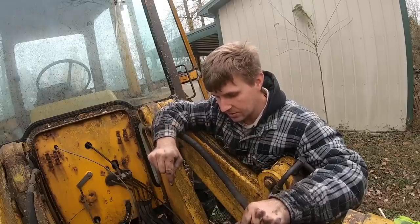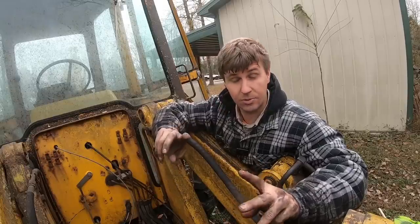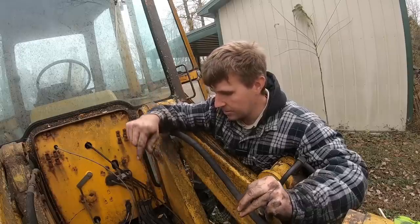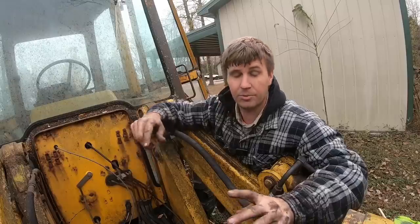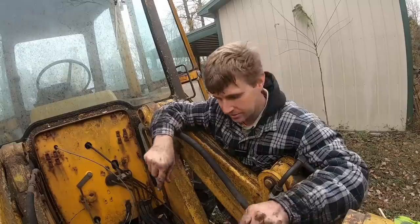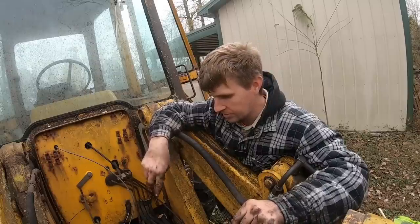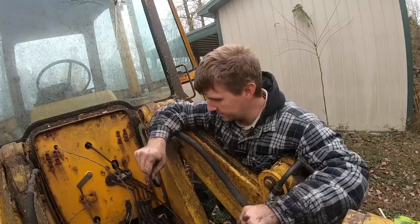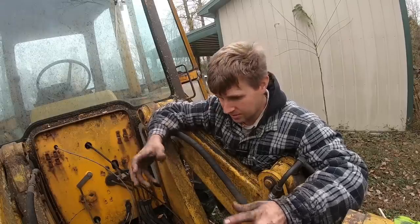We still have some things we can do, though. I do have a ball hone, and I got some tips from Clint on how to do that. We're going to run these cylinders real quick so they're cleaned out and ready to go. And I want to go ahead and address some wiring. Remember when we first hooked this up to a battery, we had some nice spicy smoke coming out of the alternator because there's a few open areas on this wiring that's been worn out. I want to go ahead and get that addressed and fixed and replace some of these ends. That way, whenever we do get the rings in, we're kind of ready to go.